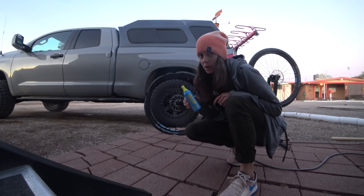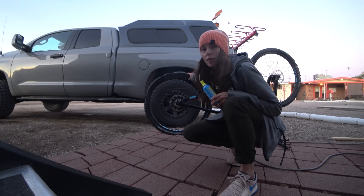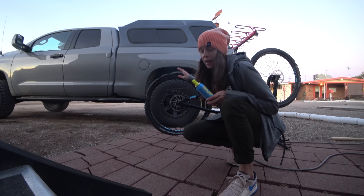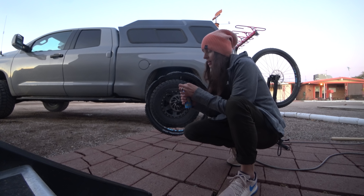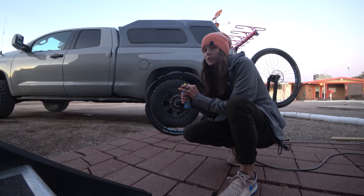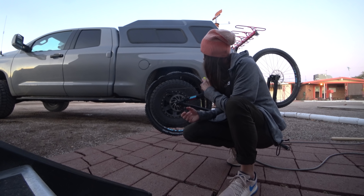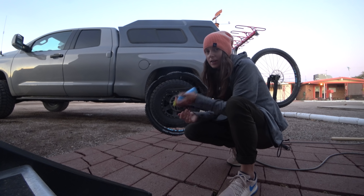This can works on both Presta and Schrader. Before I do this I want to squeeze as much of the remaining air out of the tire or tube, which I have done, and then I'm going to put the valve in the 12 o'clock position, push this on, and I'll actually have to push down on the valve a little bit just to give it enough pressure to really unload, and then just keep filling until the tire seems full enough of air and sealant.